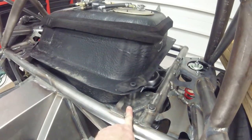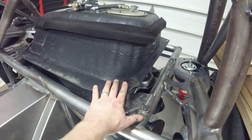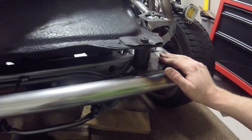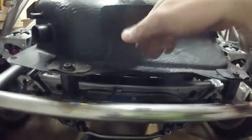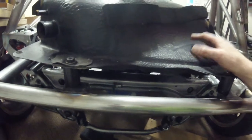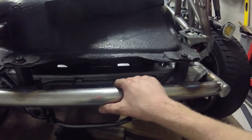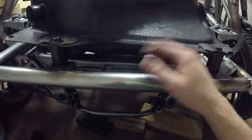If they're going to put mounts on this kit, they should either put a flat bar mount and have you get a fuel cell, or build the mounts up to extend the tank like shown to make it fit right. The brackets as they're given welded into the kit are basically completely worthless. You have to make some sort of mount to suspend the tank and get a little pitch forward. A proper aftermarket fuel cell setup — different lines, fuel pressure regulator, sender units — ends up running close to about a thousand dollars.